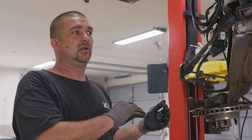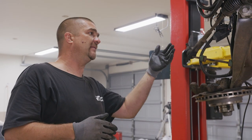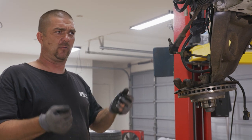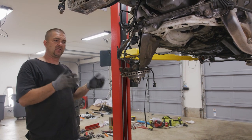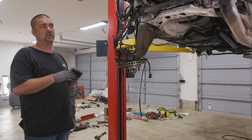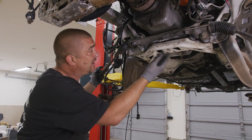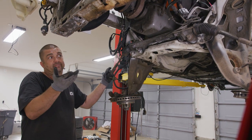I was trying to do whatever I could to get extra angle without keep modifying the spindles, because the more you modify a spindle — whether it's a bolt-on piece or whatever — you're going to sacrifice something. It could be geometry in the rack and pinion, it could be feel in the steering wheel. I actually played around and got over 80 degrees of angle, but the steering just felt whompy — it didn't feel natural. I try to get all my angle kits on every car to feel like a stock car, so the minute you get in it, you're like, 'Oh, this is natural.' Part of that was the rack and pinion. In this case we're going to keep this rack — it's not that old, I don't see anything leaking out the boots — and we'll replace the inner tie rods later.